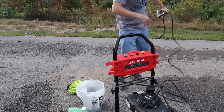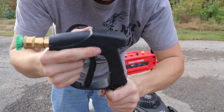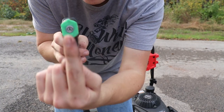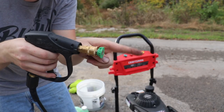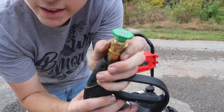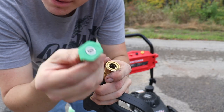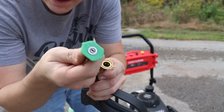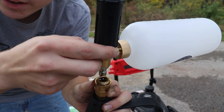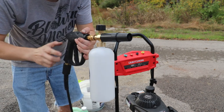Go ahead and unwind your pressure washer hose and thread it onto the stubby pressure washer wand. I always turn my nozzle straight up and down so the fan is vertical, just like a paint gun. For the foam cannon, you pull down on the quick release, pull out your green tip — that's pretty much the tip you want to use, you don't want anything harsher. Once you've got that green tip off, the quick release fitting snaps right onto there and you're ready to spray some soap.